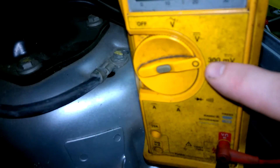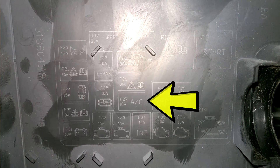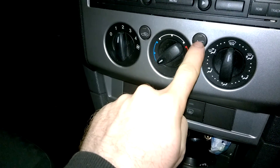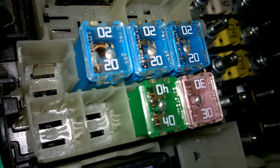The best way to do this test is called a voltage drop test. This requires no removal of fuses and is as simple as getting your multimeter and holding it across each fuse for a number of seconds, looking at the multimeter for a reading. A normal functional fuse will have a resistance which causes a voltage drop. An open or blown fuse will show a 12-volt reading across the multimeter. If we come across a fuse with a problem, the resulting multimeter reading will show it. There are conversion charts we can use to see exactly how much draw we have — I will link them in the description. If you have a J-case fuse, you will need to remove the top plastic piece before carrying out this particular test.